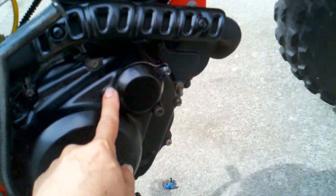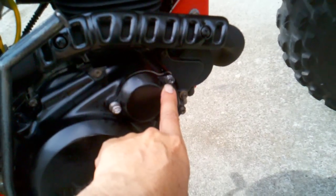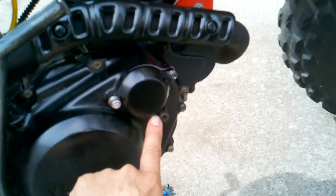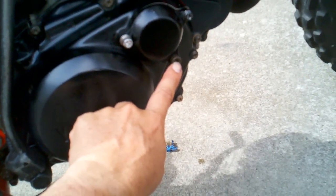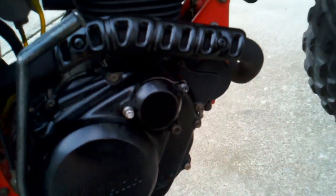That's where the oil filter's at. I replaced this one — this is a short one; this one's messed up and it's way long, so I'll have to call my bike shop and get a new one of those. I would have put another one of those in there, but this has a special shoulder on there for the o-ring so it won't leak. The o-ring in here has been replaced, the filter's been replaced.